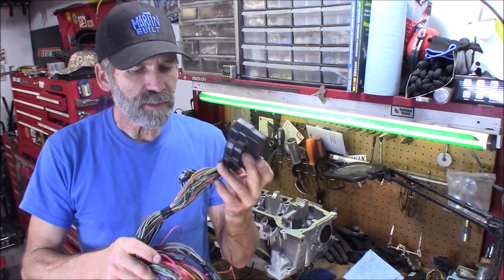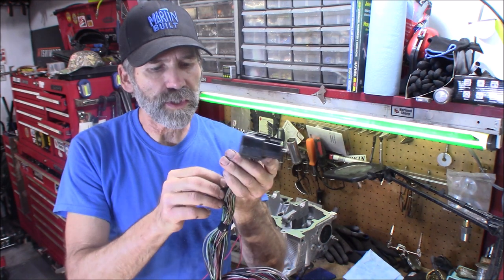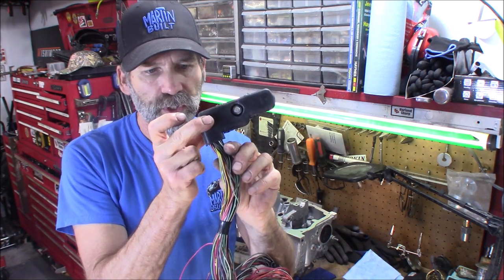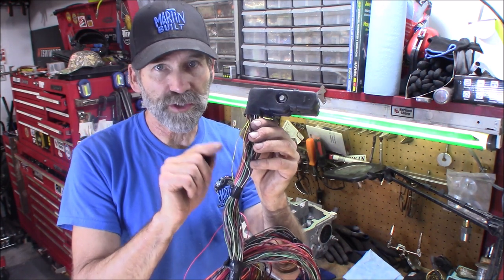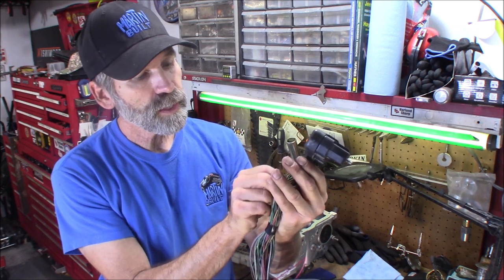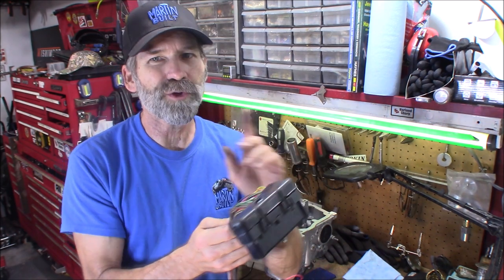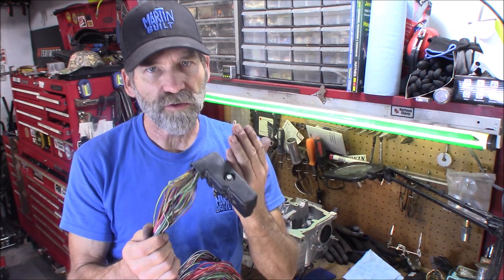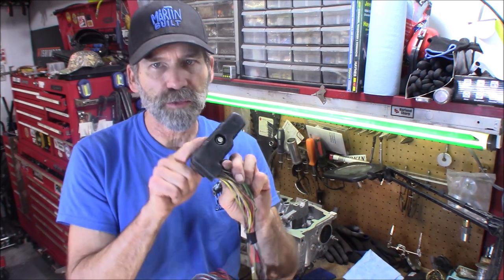This is why I got this for an upcoming video — hopefully I'll be underway on that in the next couple of weeks. Let me show you how to unload one of those terminals. When you're just going to locate the wire and cut it — make sure it's the yellow with the green stripe. There's also some other yellows in here: yellow with a red, yellow with a purple, and I believe there's a yellow with a blue. That's the one I'd be worried about. Taking the cover off and finding number 10 verifies which wire it is.